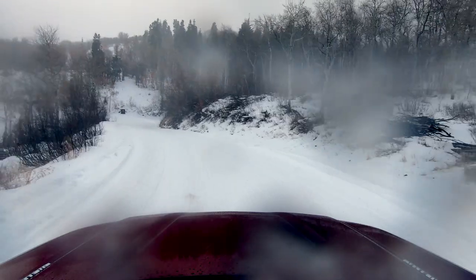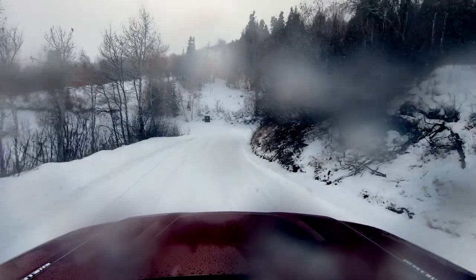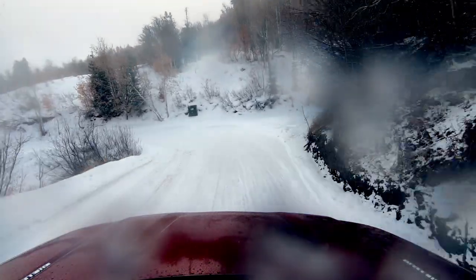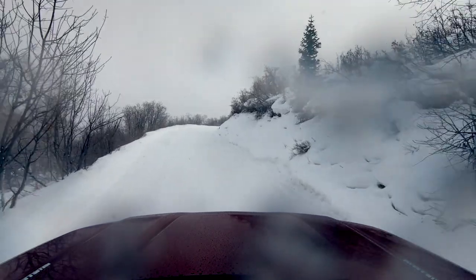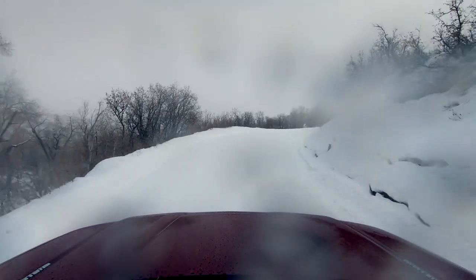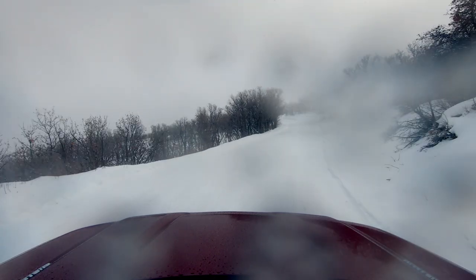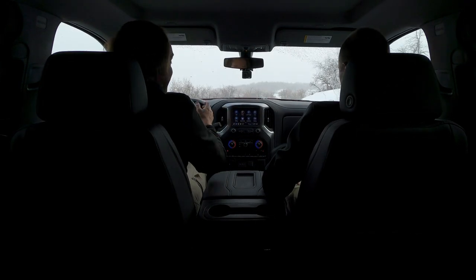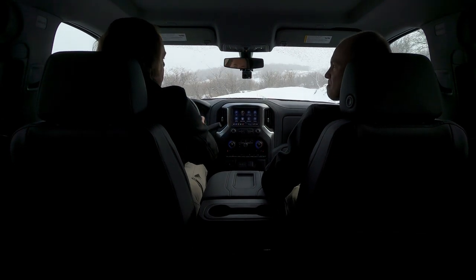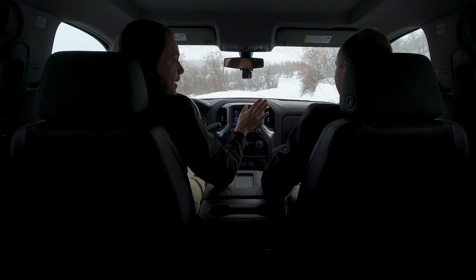I did fake myself out like a lot of people do — you put it in four high and you feel like you don't need winter tires anymore. Something gets a little slick and you realize four-wheel drive is not going to save you, especially when stopping. Only when I had it in two high was I catching myself. Four-wheel drive makes up for it a bit and starts to convince you you'll be fine, but this is nearly 6,000 pounds — it's not going to stop quickly just because you have four-wheel drive.